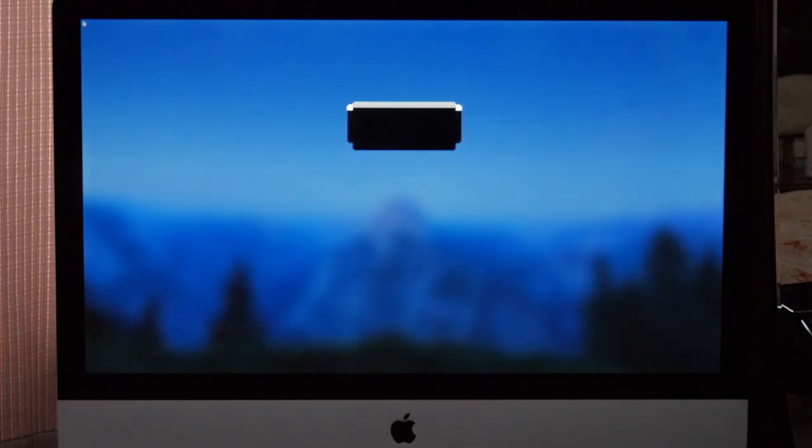Sometimes it might show artifacts on the screen, like a horizontal line, but most of the time it just locks up. Now, if I hold down the shift key, yeah, see, you can see the horizontal lines now, right? You can see some artifacts on the screen. And here, it's trying to boot, but you can see how everything's inverted. It's clearly a video card problem. And the computer is unusable, only because of the video card. Everything else about this machine works fine.